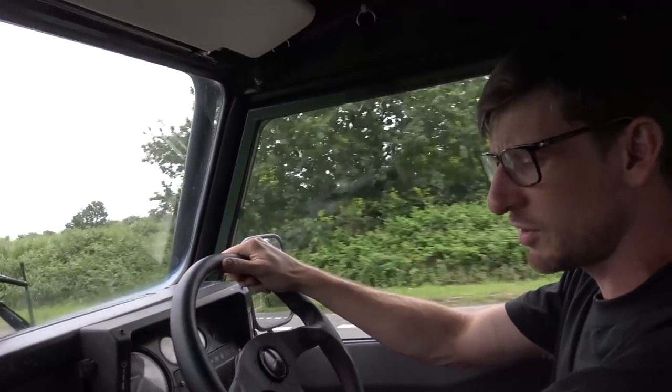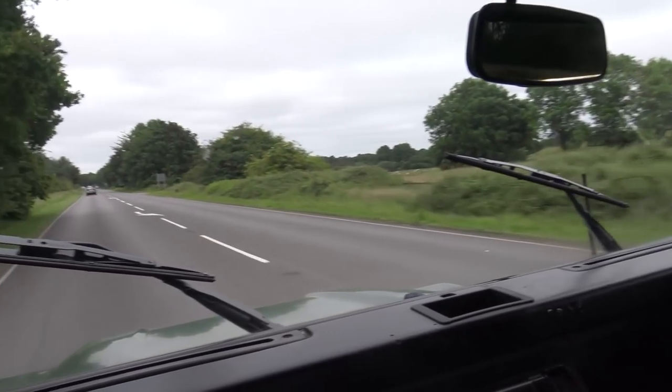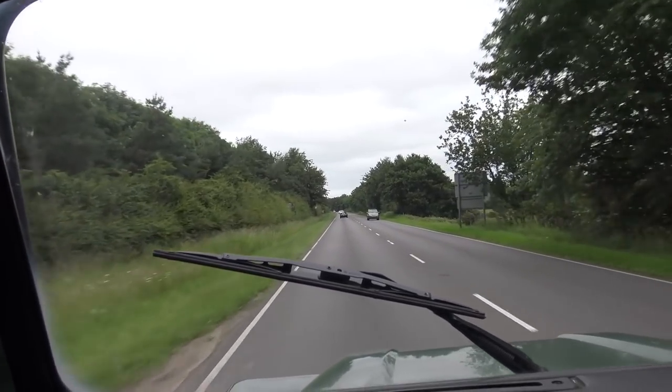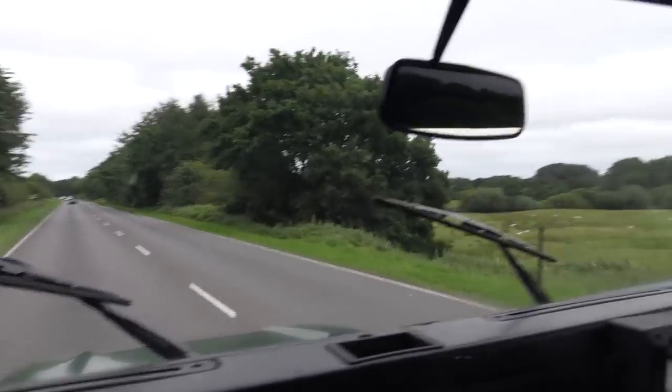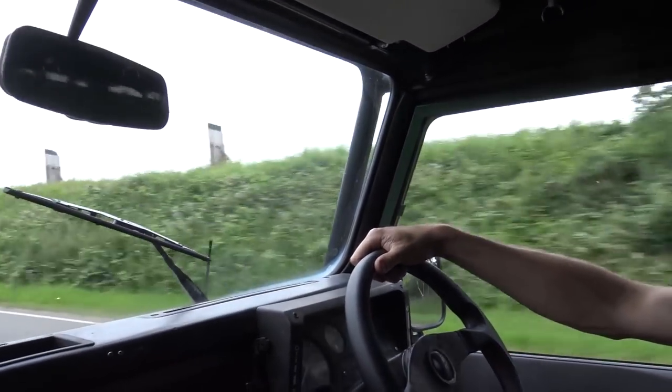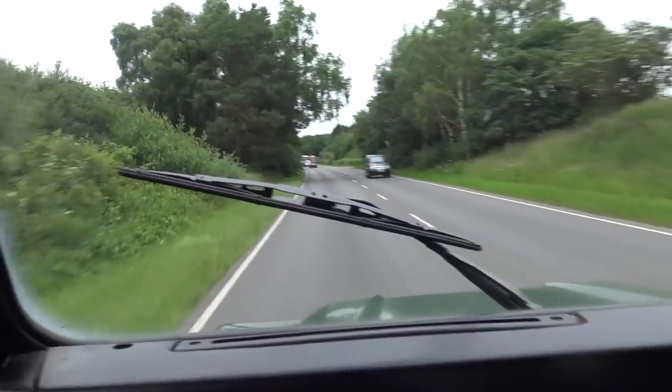Back in the 90 then - with the engine in and everything running smoothly, all eight cylinders performing well. The job's come out really, really nicely. We're just waiting for the speedo cable to be modified with a transducer in it, because the hotwire ECU likes to know if you're moving - it really helps with idle speeds. We've also got a temperature gauge on order because, as with most V8 conversions from diesels, the temperature gauge is reading high - the sender and gauge aren't calibrated, so we've got a new gauge and sender. We're also going to chip the ECU just to get that refinement in the fuelling system.